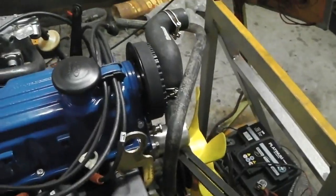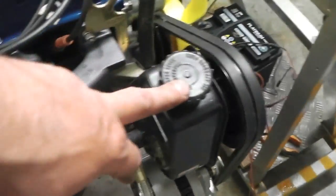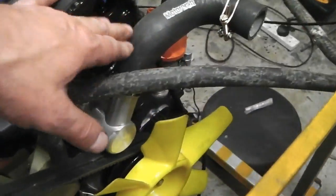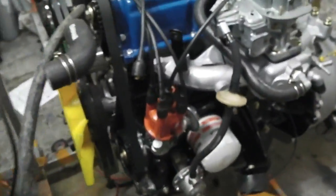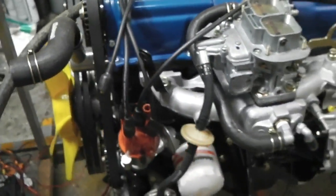We've got no spark yet. We need to look at the power pump situation because I don't want to run that dry, it'll burn it out. We've got a radiator to fit and we've got a temperature sender to fit into the cylinder head, otherwise water's going to pour out of the hole where the temp sender goes, which is just in here, temp sender. I've got one somewhere, we'll dig that out.